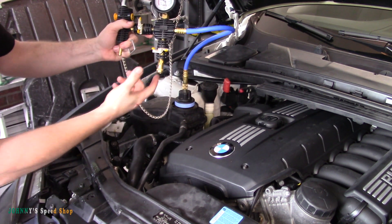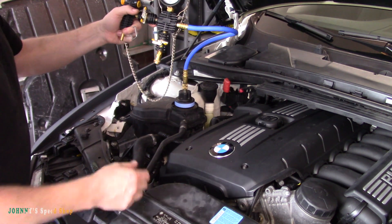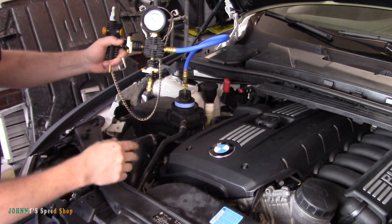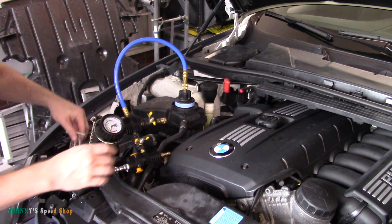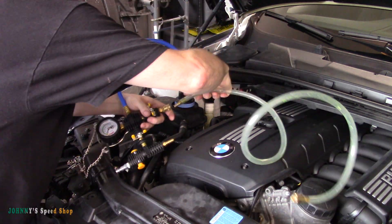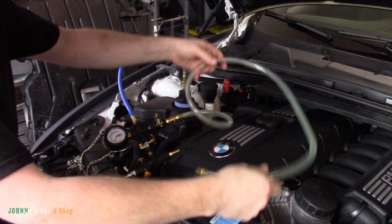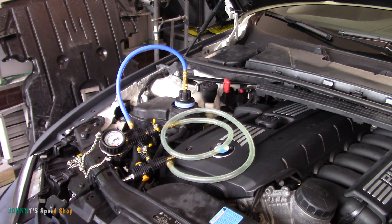What we're going to do next is hook up here, drop the other end of the hose into our coolant jug, and fill the system. If you look at your radiator hoses - all the hoses for the coolant system - they're all squeezed flat. That's how it works. Let me grab our suction hose and we'll drop this end into a jug of coolant.